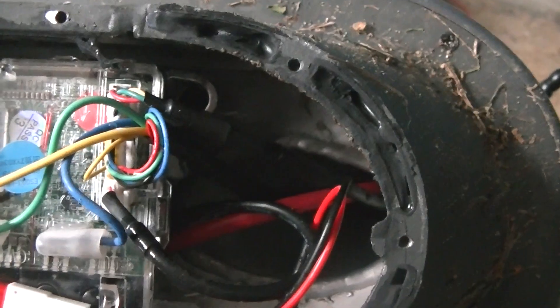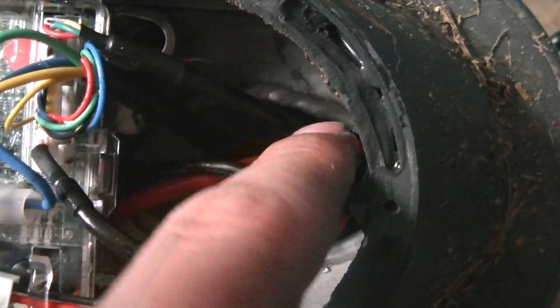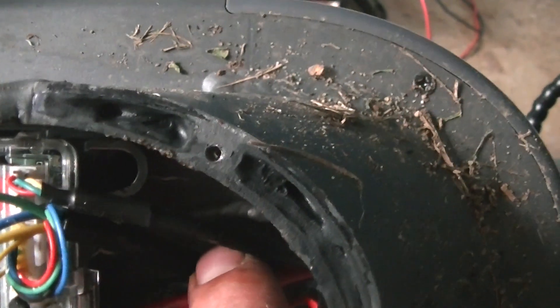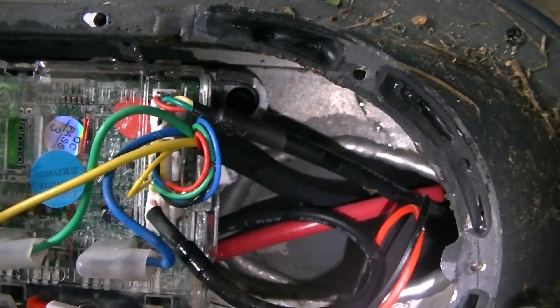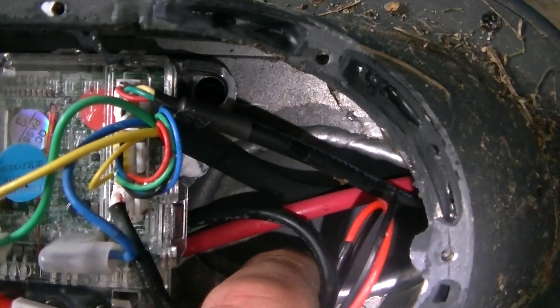What is the solution to this? Well, it's actually pretty simple. You see this bit here where there's this bit of tube — put the wires through here, or run the wires externally. I'd say run the wires externally, so there's less chance of water getting in, because the water's actually got a head — it's got some pressure behind it if it fills up the whole head tube with water. So run the cables externally and weld up this opening. That's what they should have done from the factory.